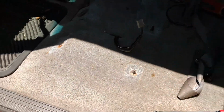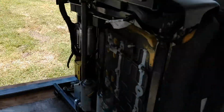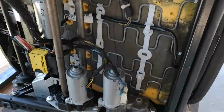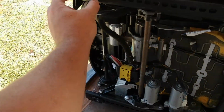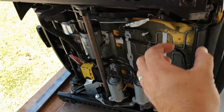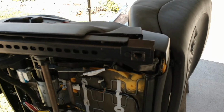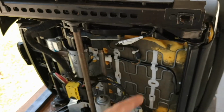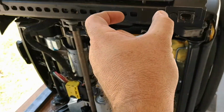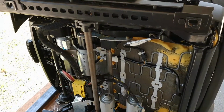So the plan is to do what I did last time, which is cut a length here, install it, cut a length here, fill out the metal part here to make this nice and squared off. Then, since I know that the distance going from here to here is the same regardless of where it mounts this direction, I'm going to do a bar this way and a bar this way, and then I'll build feet off of that.